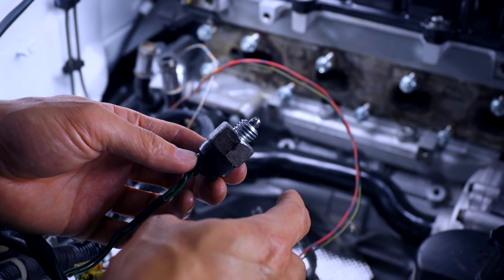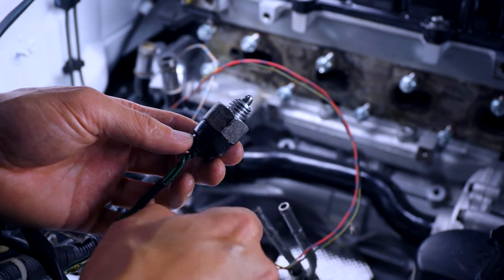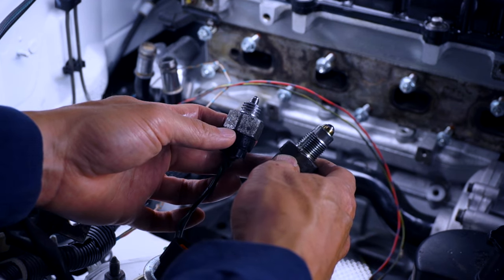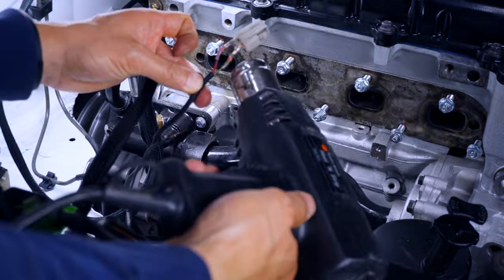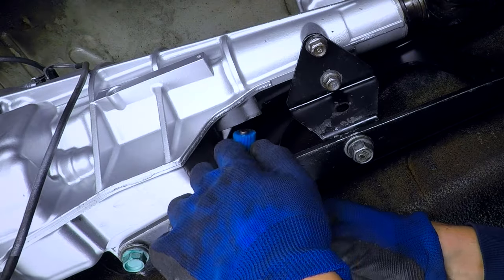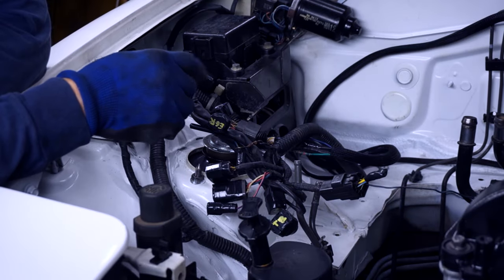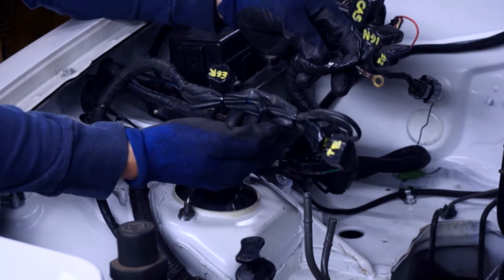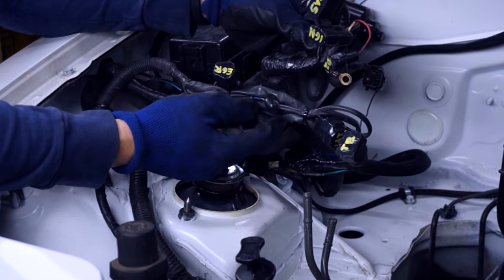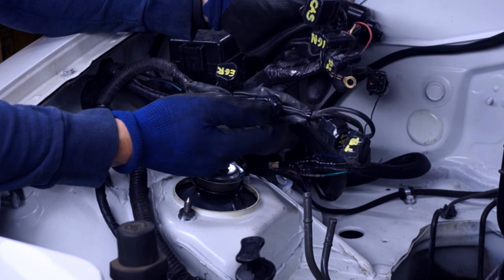Now is the time to wire up the transmission. As a reminder, I used to have a five-speed in this car, but now with this Ecotec motor I've mated it with a six-speed transmission from an NB. This is the five-speed trans reverse switch, and we need to replace it with this one from the six-speed — thankfully we just need to cut and connect the plug. I'm in the wiring weeds right now. I've done a few things and made a few mistakes. With all these existing unused Miata plugs, I've taped them up, labeled them, bundled them up, and I plan to tuck them in behind the fuse box. You could remove them all and weed out all the wires from the harness — which would save a lot of weight — but it's a lot of effort that I'm not willing to expend right now. Maybe not ever.